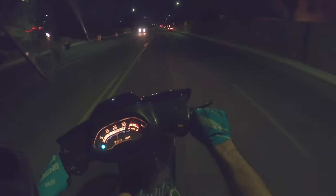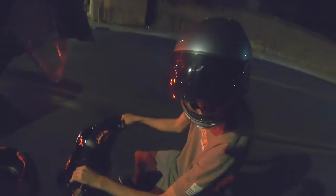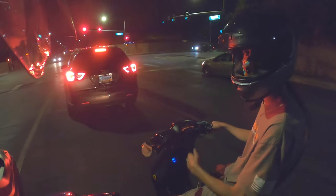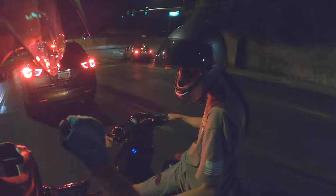Having a hard time picking this thing up. How did it feel when you're trying to pull it up? Not enough power, right? Yeah, it's lacking something in fuel then. For sure. It needs more fuel. When you throw the load on it, it's like, yeah. You should be wanting to lift up. Right.